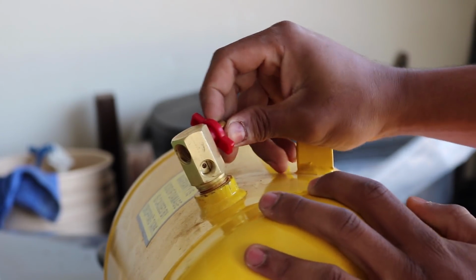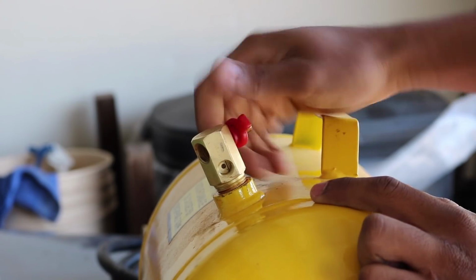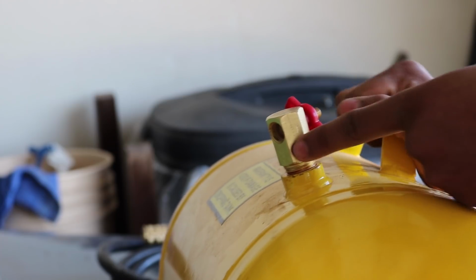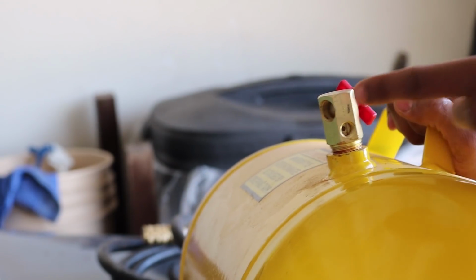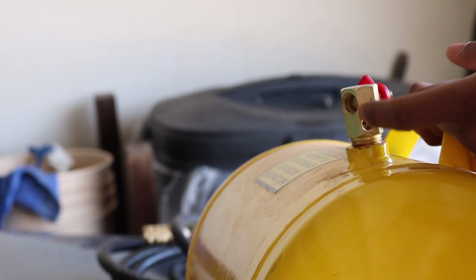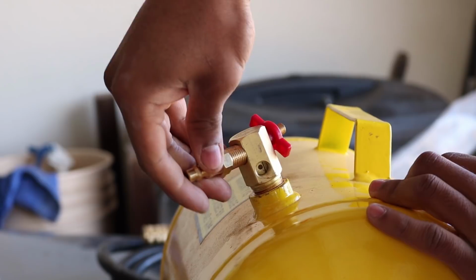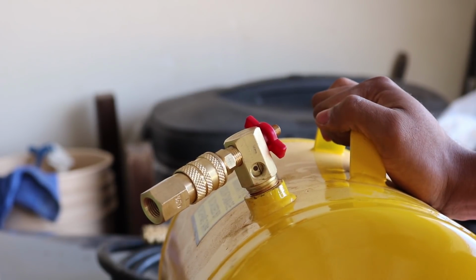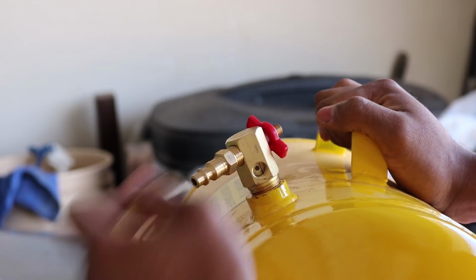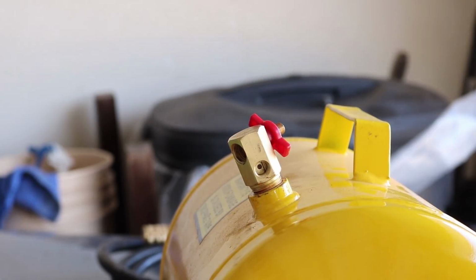And how you input air into the tank is through this air chuck right here, and this is the release. This is how to turn it on. This right here is your output for your gauge. That's always on. And then this right here is for your output of your air, and that's where I'm going to put this quick connect, so I can just quick connect my hose just like that. Should be really easy and simple. So now I'm just going to get the Teflon tape and start tightening everything down and putting everything on the manifold here.